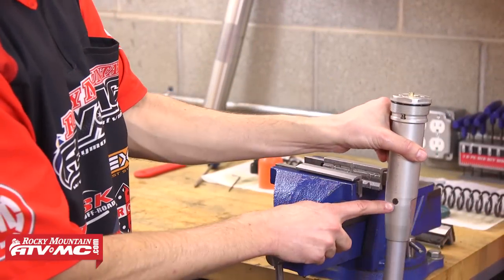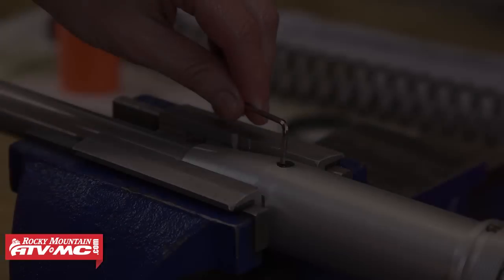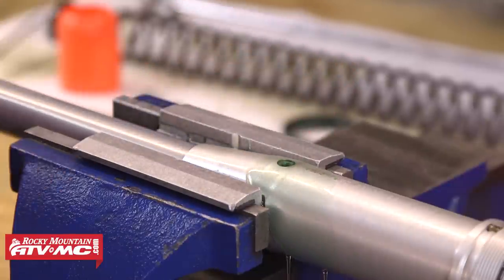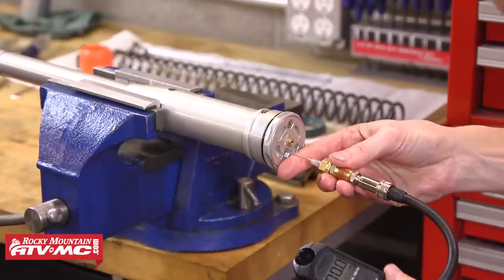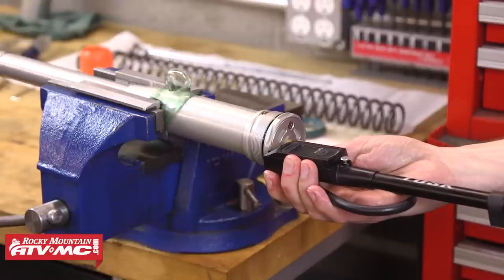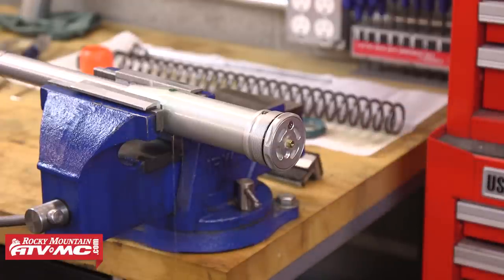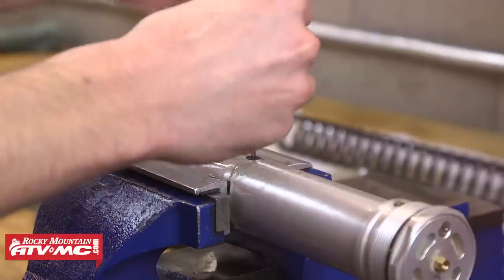After that we're going to remove the fork from the vise and reclamp it with the filler port as the highest point. Use a 2.5mm allen wrench to remove that filler port screw — there's also a small o-ring underneath that you'll want to keep with the screw. The point of this next step is to get the correct oil volume inside the cartridge and the correct air volume inside the bladder. We've got our Racetech needle mounted onto our tusk digital suspension pump, and we're going to pump the bladder up to 7 psi. As we do this it's going to expand the bladder and also push oil out of the cartridge, so we've got our catch pan underneath. After we have 7 psi added to the bladder we should now have the correct volume of oil inside the cartridge, so reinstall that filler port screw and o-ring being careful not to over-tighten the screw.